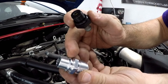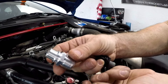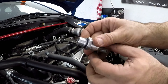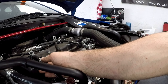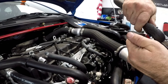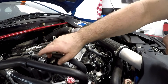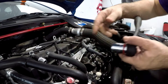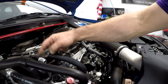As you can see in the kit, the new metal fitting is the same thread type and will replace the old one so we can connect our 10AN 45-degree angle. Move the little rubber ring from the old fitting into the slot on the new one — same style gap. Then thread the new fitting back in. Caution: this valve cover is plastic, and even aluminum can flex. Just get it a couple of cranks — five to ten pounds of pressure maximum. You do not want to over-crank and strip the threads.